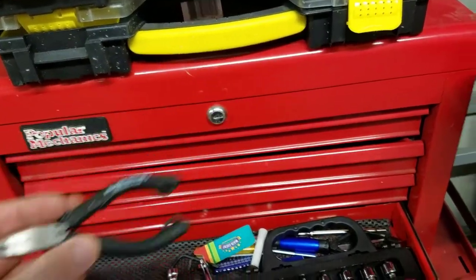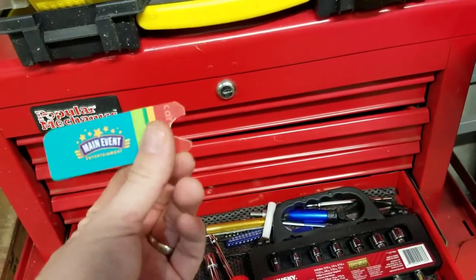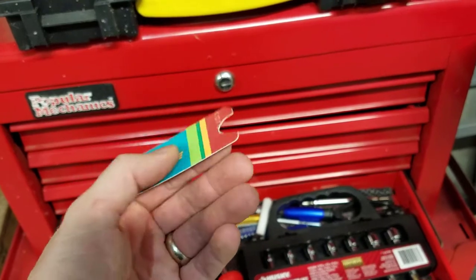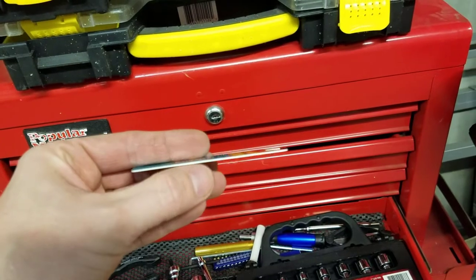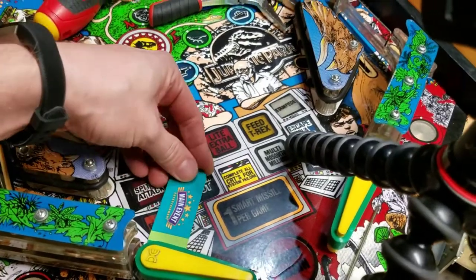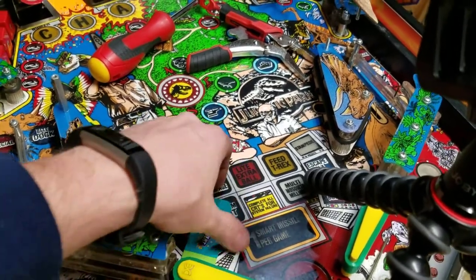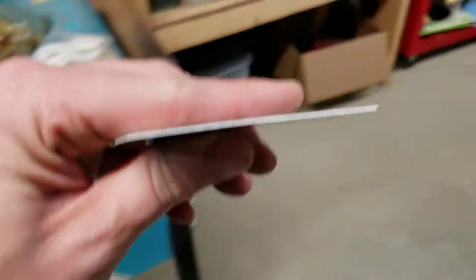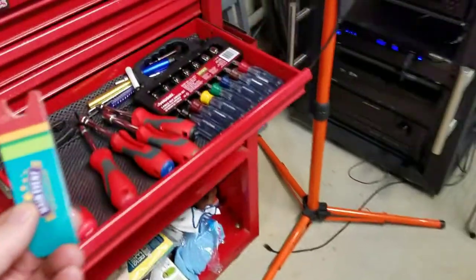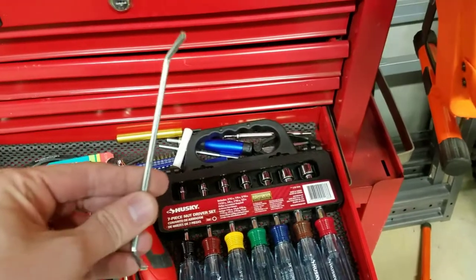This is something I made from a card from Main Event — kind of like a Dave & Buster's. It's my little socket for measuring flipper width between the bushing and the flipper shaft on a playfield, so you can fit it right between the flipper bushing to ensure there's enough room and you're not causing angel wings on the playfield. Just take an old credit card, which is about the width you need, and you've got yourself a tool.